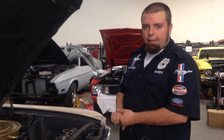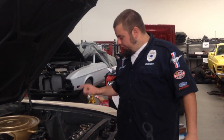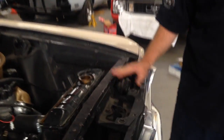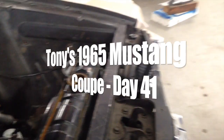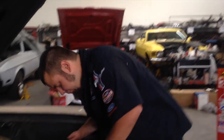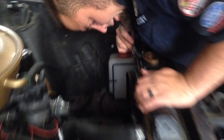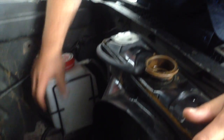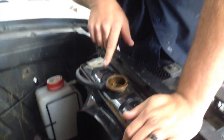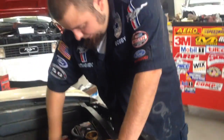Alright Tony, getting ready to do your radiator. Got the cap off, here comes the details. The first thing I'm going to do is drain the coolant. As we know, we had a leak right here on the top tank. And you can see it even drained your overflow tank here, because it would drop back in and push it out instead of going back in.